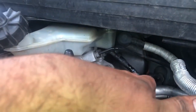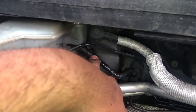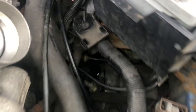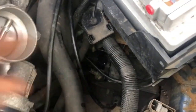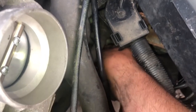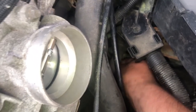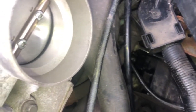If you come under here we've got our master cylinder — these are for the brakes, the steel hard lines, and that one is for the clutch. So it all runs from the same master cylinder. That should do it — it's been running for about 30 seconds. So tighten the nipple and then push the clip back in. Now the nipple's tight, we can secure it with the clip.